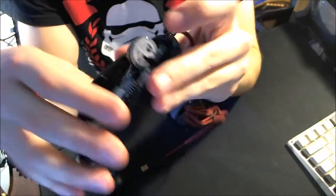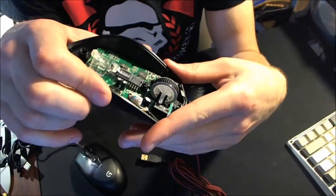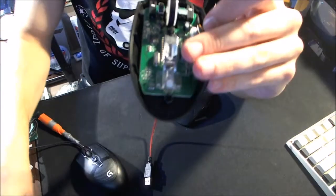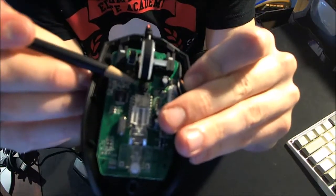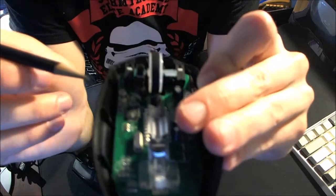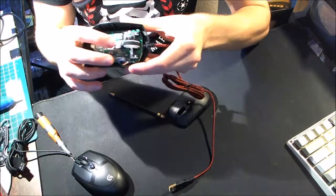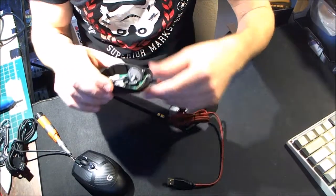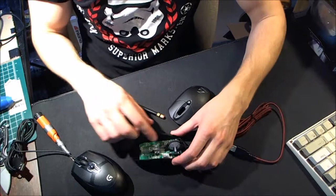This whole PCB is held in by 2 screws on the left and right. Scroll wheel is just a pretty standard TTC encoder. It looks like a shorter profile one. For the DPI and scroll wheel buttons, they are the black box push button style. It looks like those are soldered in at 2 points, so those can actually be swapped out for other similar 2-pin micro switches.